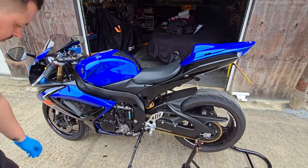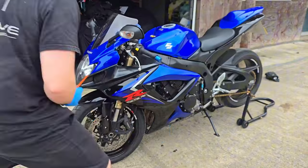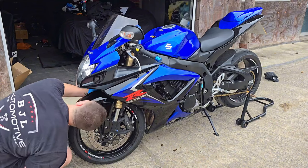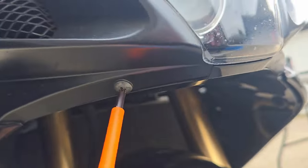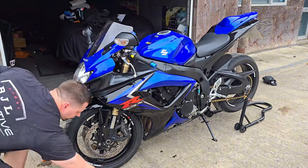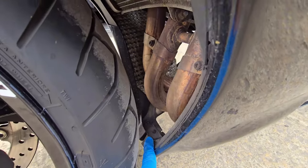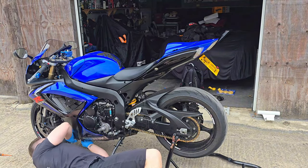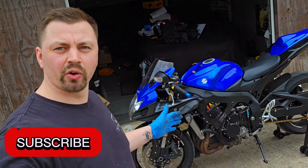Moving down, there's another allen-headed bolt to remove. Then we need to come around to the front of the bike to remove the underbody panel. To get this off you need to take off the four plastic fixings — just poke the middle bit through with a screwdriver and they fall out. Then there are two Phillips screws holding on the front bit and you can unclip and remove the panel completely. Once you've removed the last bolt, give the panel a wiggle and it comes off. The bike is now secure and the panel is removed.